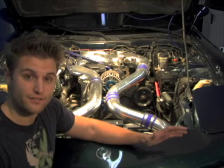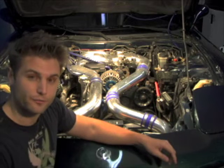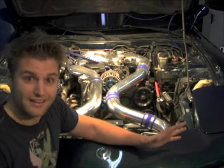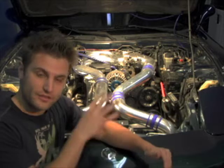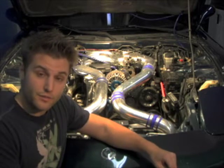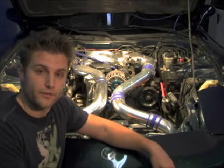A car like the Mazda RX-7 was already turbocharged by the manufacturer, so it's important to look for a blow-off valve first before trying to install anything or mess with anything on the car. A blow-off valve can be found on two sides of the intercooler — both the side that the turbochargers come from and the intake. On the '93 Mazda RX-7, you'll find it actually by the turbos, which is the more common location.